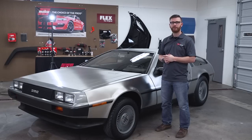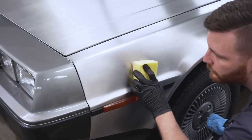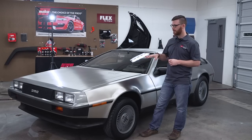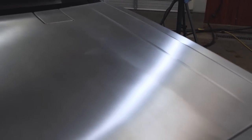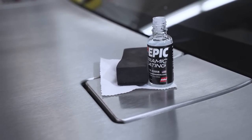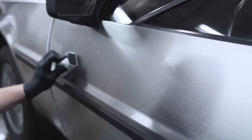This is where we decided to get a little creative. I started off with some paste wax on a foam applicator block — actually a tire dressing applicator, brand new. I was working front to back, kind of going with the grain of the stainless, because in these grooves the stainless was still holding a lot of dirt and grime. This whole car when it came in had almost like a yellow tinge to it — just like when you clay bar a paint surface and get all that extra grime off. We ended up moving away from the wax because it was a little time consuming and we only had this car for a day. So I got the ceramic out and used the standard application method, but instead of a crosshatch pattern I tended to go front to back, really using it as a gloss additive.